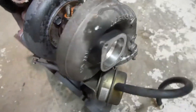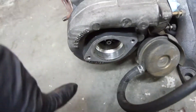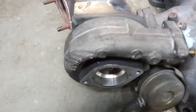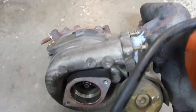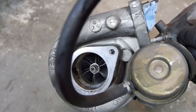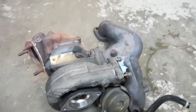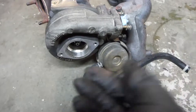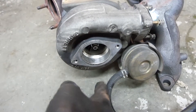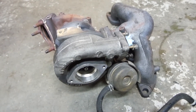I've been able to check the turbo. There's actually quite a bit of oil pulled down in here, so I think probably the bearing, or like the oil seal on the turbo, is cooked. I have rebuilt them before. Eventually the turbo is going to get replaced probably with something else, so maybe I'll just leave it for now rather than cracking that thing open and rebuilding it — although it's already off the car. There's a decent amount of shaft play and some oil in there, so maybe I will order a new oil seal for it.